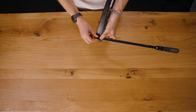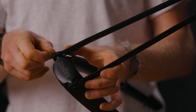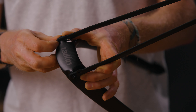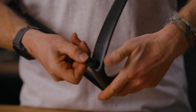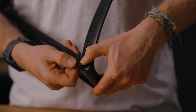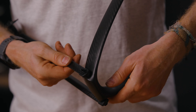Once you've got it pushed on and you can see the groove on each side, the retaining clip needs to be put back over so it sits inside that groove. Use your fingers to tease it in place — it might take a couple of goes but once it's in it's actually very simple. I tend to use my nail to make sure it's in fully. Once that's in you should be able to see it sitting in the slot. Do the same for the other side, running it around to make sure everything is securely in place. Once you've pushed the topstay on and put the retaining clips back into their groove, that is your rack set up.